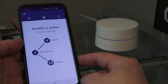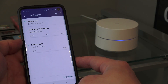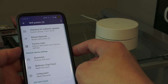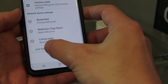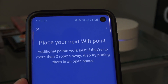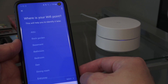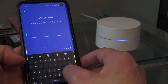Get your Google Wi-Fi app. You can see I've got three Wi-Fi points already and a crazy number of devices — 33. Now we're adding a new Wi-Fi point. Go into the settings button and then down at the very bottom of the screen, tap 'Add Wi-Fi point.' It tells you to plug it into a power connection, then say where it's located and label it.